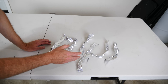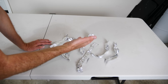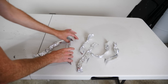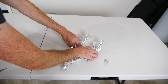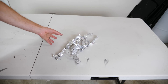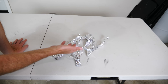The way that microwaves heat your food is basically: imagine these are sugar molecules or water molecules, and in your microwave oven you have microwave radiation — an alternating electrical signal going from positive to negative to positive to negative. Because these molecules have positive and negative charges at either end, as soon as the radiation goes by they flip back and forth, and that vibrating of the molecules just causes them to heat up. That's all microwave radiation does — it heats things up.